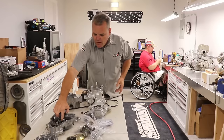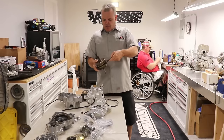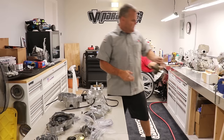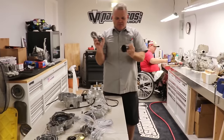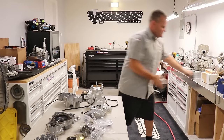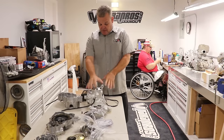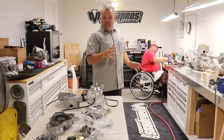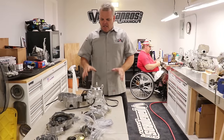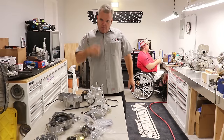You can see we got worn clutch plates, crank. Crank is very old and worn, so it needs a new crank, piston and main bearings, same time. So it was time for a rebuild, perfect time. And luckily the cylinder's still in good shape. So Brad's gonna assemble this entire engine. He's gonna clean the power valve at the same time and put this whole thing together with new clutch plates and so forth. We'll report back to you.